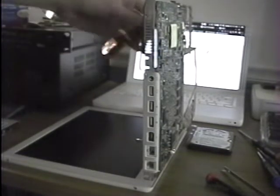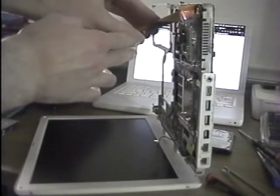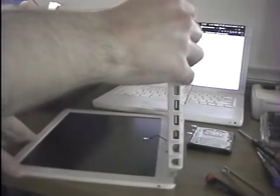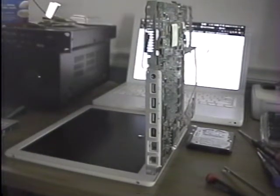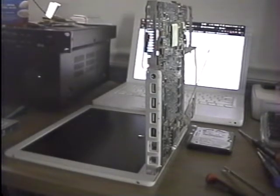An interesting thing about the hard drive connector: there are white pinholes, and I'm not sure what they are — whether the white indicates there's no contact, or if they're special in some way. Two of the white pinholes are actually on the jumpers, which might mean I don't need to modify the jumpers at all. While I'm still trying to find information on that, I can go ahead and install the optical drive.